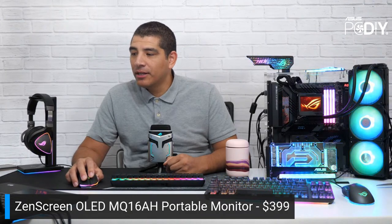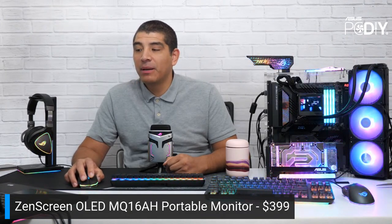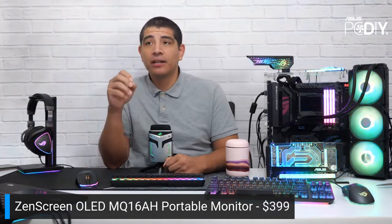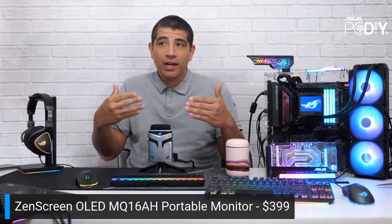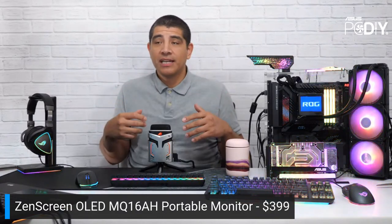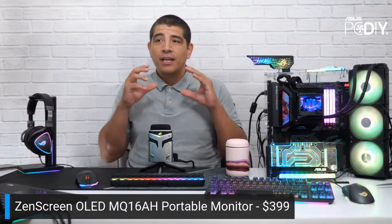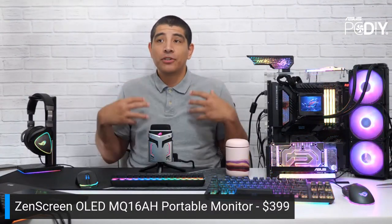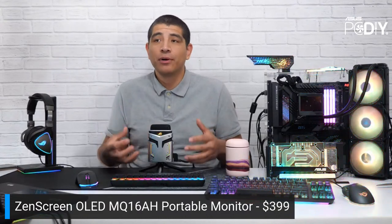Yeah, Evo, I think, was asking, or somebody was asking to clarify what I meant by the proximity for the burn-in. Essentially, the proximity sensor, right? So that the display, when the display's not on, because of the way that OLED works, it's essentially an emissive-based technology. If those pixels are turned off with the proximity sensor, that means you're reducing the likelihood of getting any type of burn-in, right?